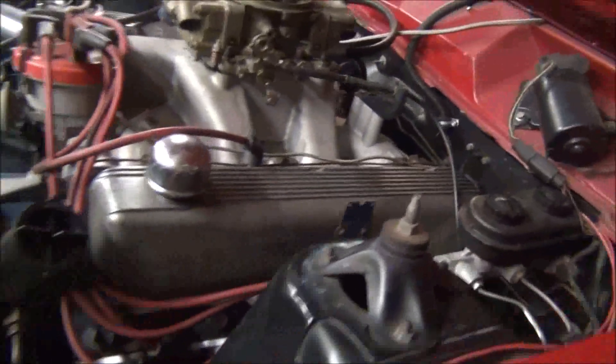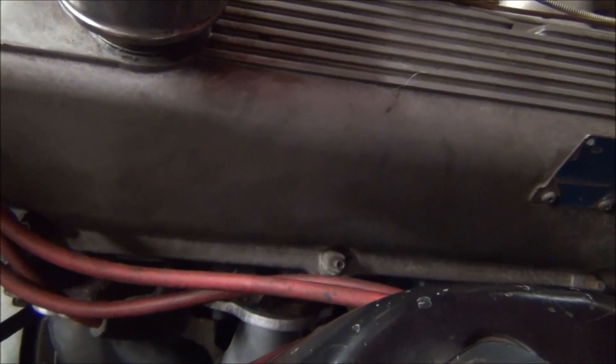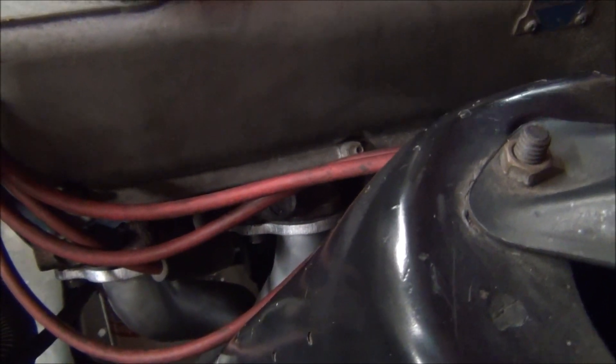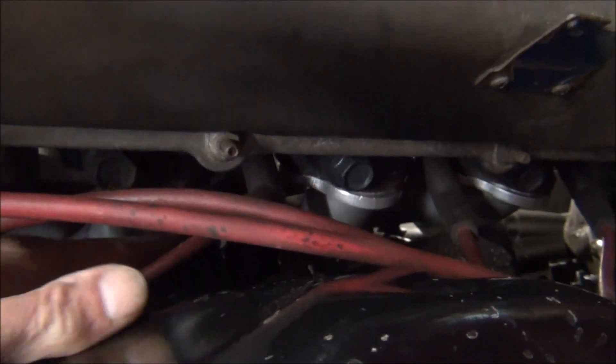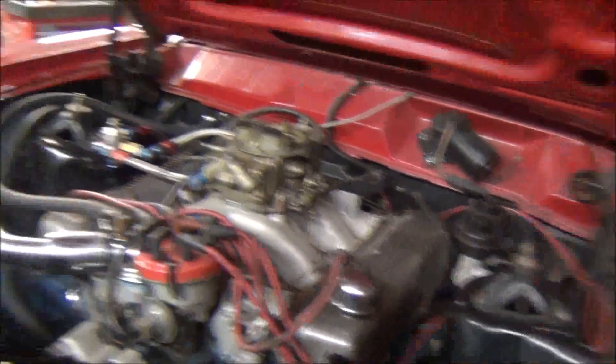That's what it looks like underneath. I'll probably do a little tweaking and bending, hopefully to get that a little further away from that pipe. If there's any rattling, I will deal with that once I get it running. The exhaust has some leaks — I'm gonna fix that, hopefully next week. I ran into a hassle on the driver's side header: I had a stripped out exhaust bolt, 3/8ths-16 thread. I ended up running a 7/16ths-14 tap. I spent most of the week, a couple of hours every day after work, dealing with that. I had to take the headers back off and stick a tap down in that tight place, and it took me a good hour just to get the tap in and out because it was just really slow going.